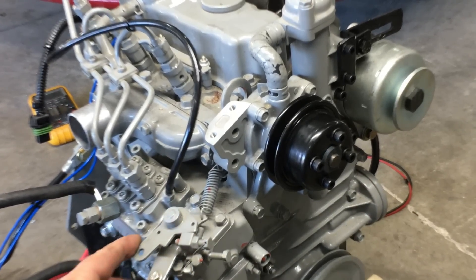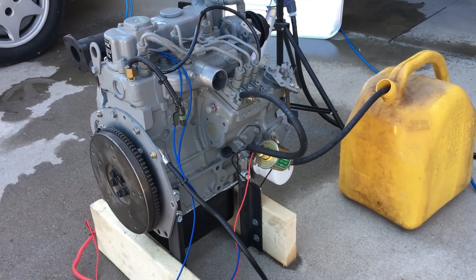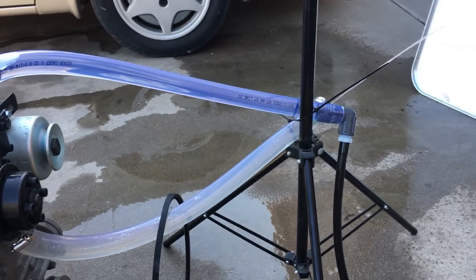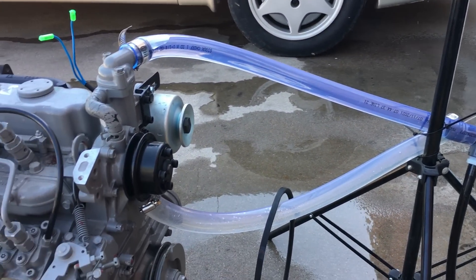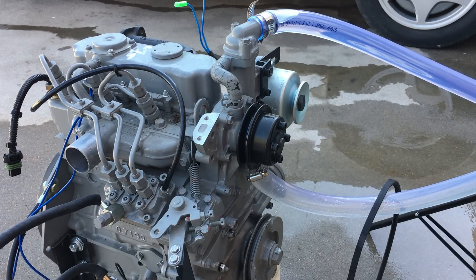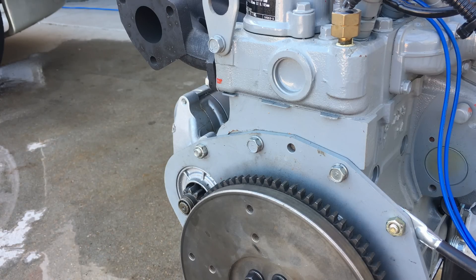Let's try this again outside the building with some water flowing through the cooling system. It took a bit of Home Depot engineering, but I managed to find enough plumbing parts to connect this to my garden hose. For the output side of the cooling system, I 3D printed a cap for the hose and drilled a tiny hole to allow water to exit the engine at a slower speed — this helps the water absorb the heat generated by the engine when it's running. Too big a hole and the engine will run cold; too small and the engine will overheat. I want to run the engine for at least 20 minutes to check for oil leaks, so let's start this little engine up.